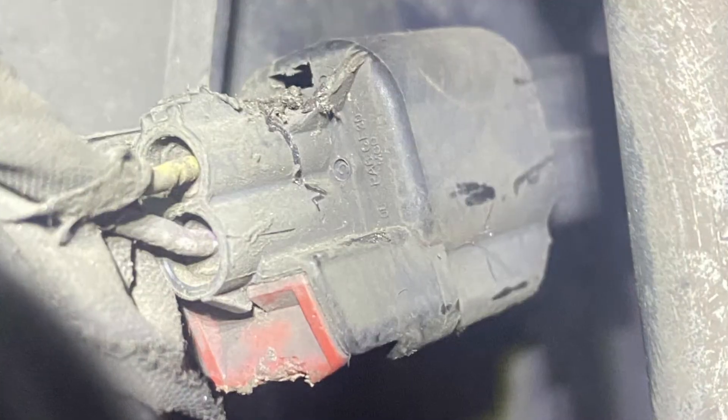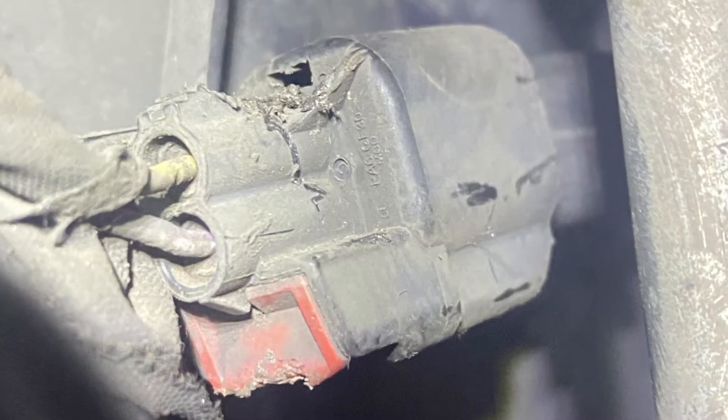What you need to do in this case is take an OBD2 scanner, plug it into the OBD2 port of your car, and identify exactly which wheel is malfunctioning. Then you can replace the ABS sensor, which is a pretty easy job on a Ford Fusion.